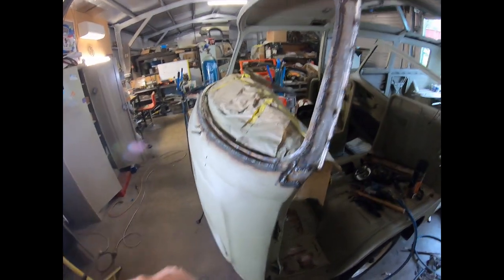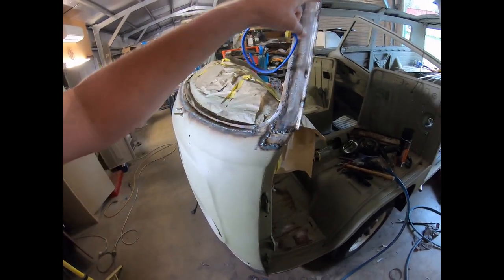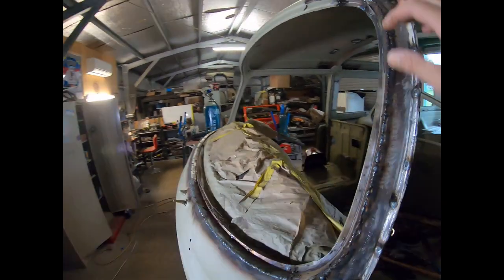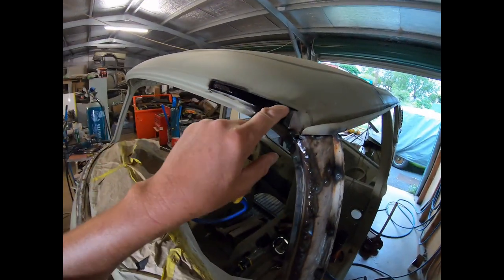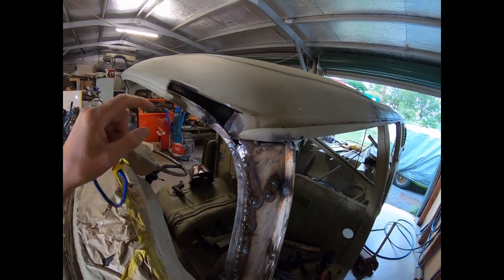This took quite a bit of repair on the A-pillar because the internal was rotten. So we had to cut the section out and weld that up. Everything gets rust-treated on the inside, and then this outer skin was welded up and folded around that back edge like factory. There's a bit of work to be done in this part up here, but Andrew's flooded that with rust treatment and it's all going to be sorted. The inside of the welds — when I shoot the rust-preventative stuff all the way around, all on the inside of the roof, right through — if only the factory did that 50 years ago.